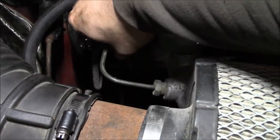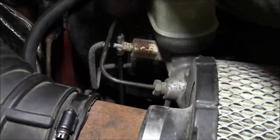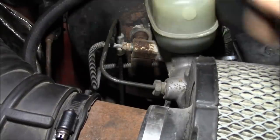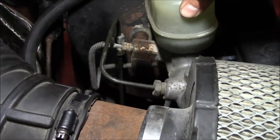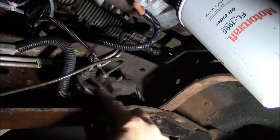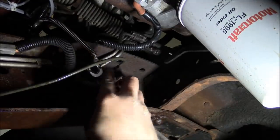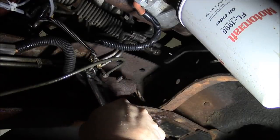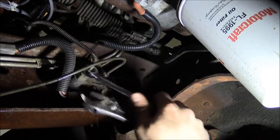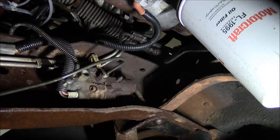The one on the ABS valve won't be that easy. Let me grab a diaper — that's going to spill oil pretty much everywhere. See that old guy right there? That is a brass compression fitting. That is super dangerous and illegal in most states, so we're going to deal with that too. Here's the other end of the line, and it comes down to this rear ABS valve. This generation of trucks only has ABS on the rear axle, which is pretty much useless. There's some kind of a clip up there I'll have to undo, and then we can sneak that thing out of there.